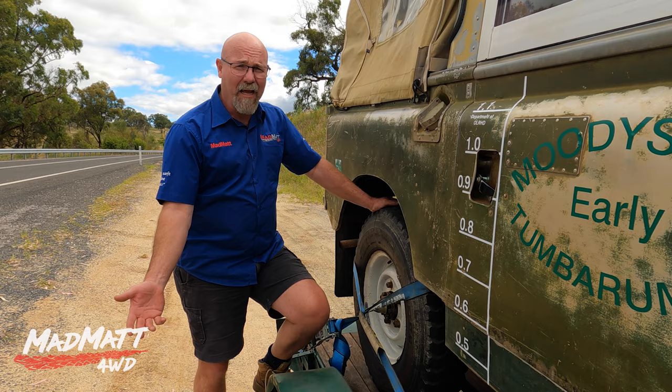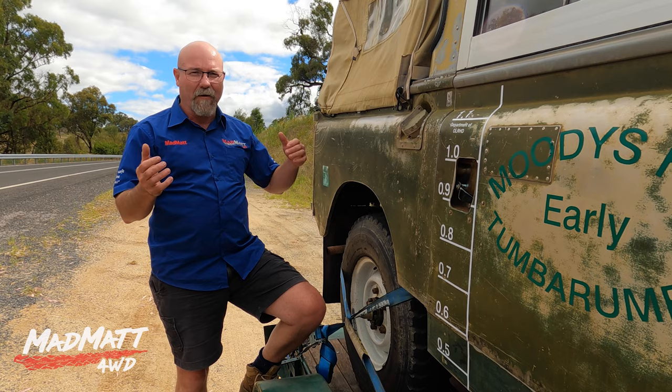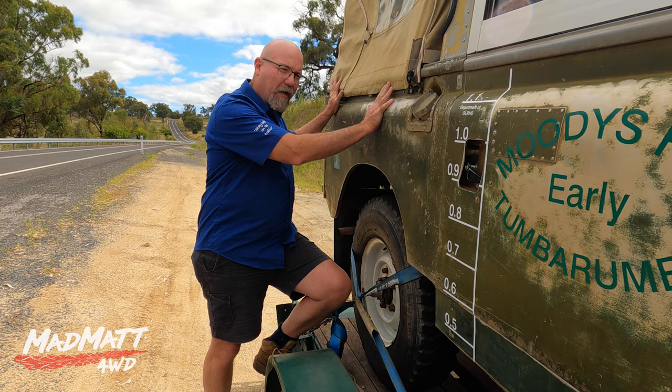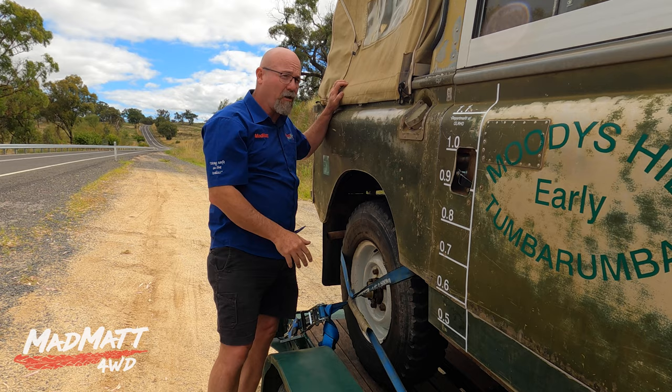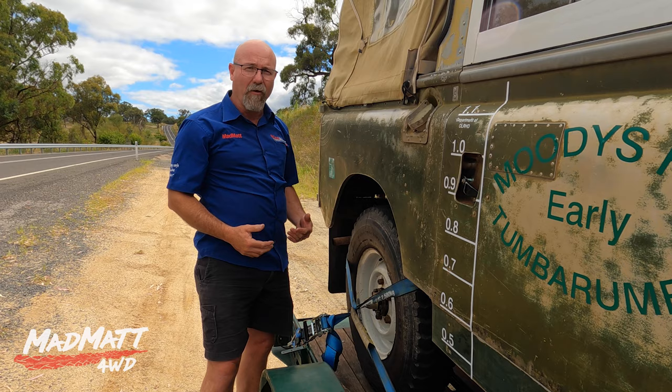The other problem was he'd tied the body to the trailer. You always want the body to be able to move and flex and roll around. The reason you don't tie the body of the vehicle to the trailer is it's going to move. It doesn't matter how tight you strap that body down, it's going to move, and by moving like that your straps and chains are going to come loose and your load is not going to be secure. So let the body move on its suspension.